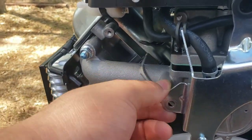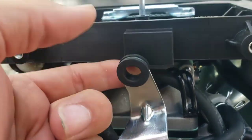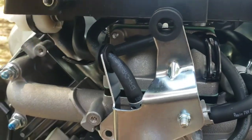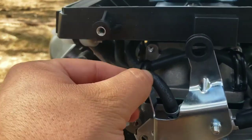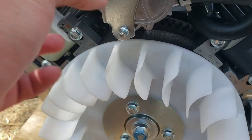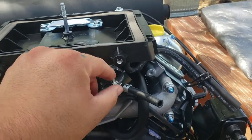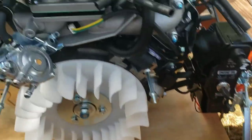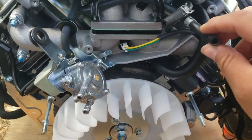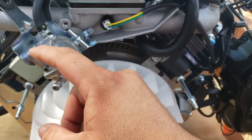So we got the 8mm bolt out. This up here was up inside this groove area back here. I guess it's just a noise dampener because it doesn't bolt to anything. Get your fuel line, it's got a little protection here. So now it's just to disconnect things so I can get this flipped over, see what bolts it is. Alright, so I could squeeze this with my fingers, but not wide enough open. Use the pliers. Got them to move back, and it's just a matter of getting them to twist loose from being on here. I did the air one off first, and then the fuel inlet. I'll do the fuel outlet right now, but let's see what size that is.